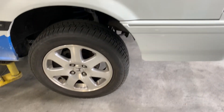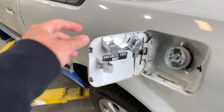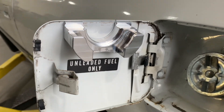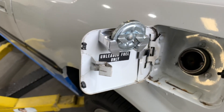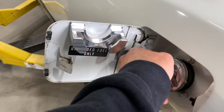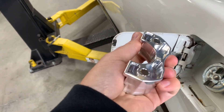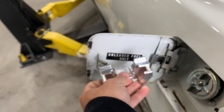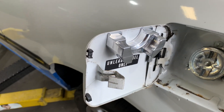The last thing I've been working on is probably my favorite and most important product for any car like this. My daily driver is a '91 Civic Sedan, and one of my biggest gripes is that every time I get gas, I have to set my gas cap on my trunk. So I decided to come up with a solution that coincidentally works on both the BA4 Prelude and the EF Honda Civic. It's a billet gas cap holder machined from 6061 aluminum, and it uses rare earth magnets to hold it to the gas door. These are incredibly strong and can hold up to 10 pounds a piece. I've also done quite a bit of pocketing on the back side to make it lightweight. It's easy to install — just snaps into place and solves that problem of where do I put my gas cap.